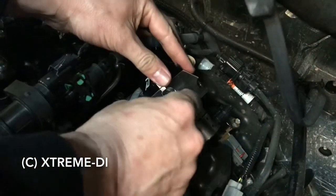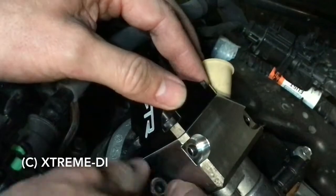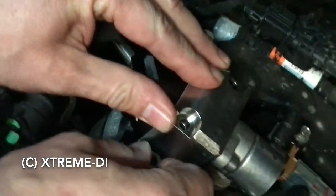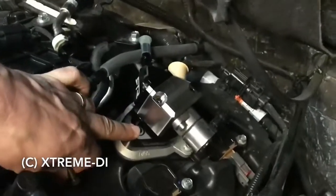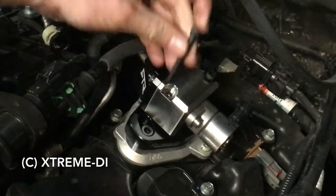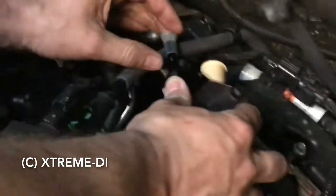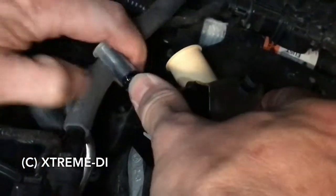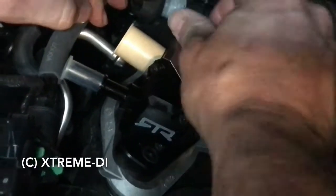Now insert the big bolts. Oh, you need a wrench. Okay, now that you have the flange bolts torqued down, next step is clock the pump and torque these bolts down. So you want to put them in first. That makes it easier to find the right clocking. Turn it counterclockwise, move this a little bit out of the way, till the bolts snap in. Now they snapped in. Okay. Finger tighten it a little bit.